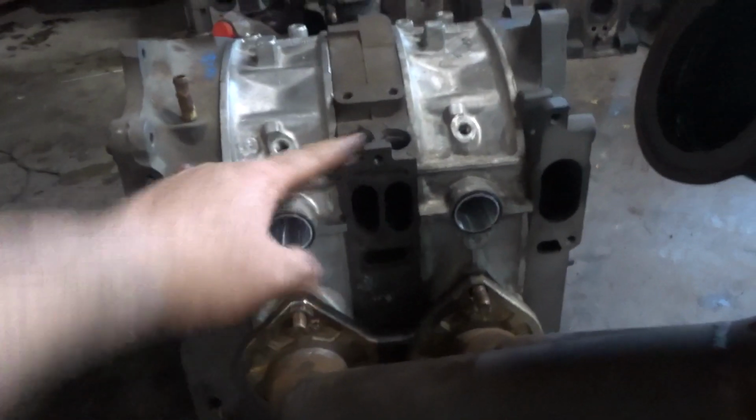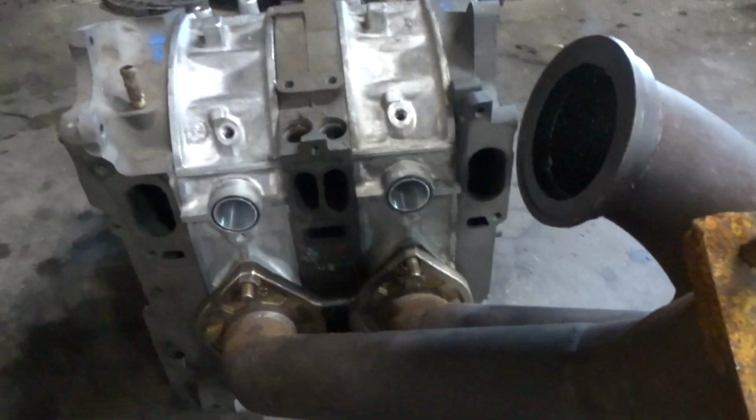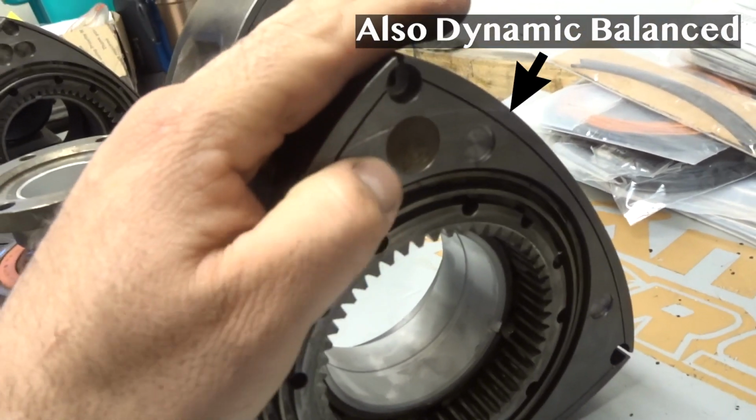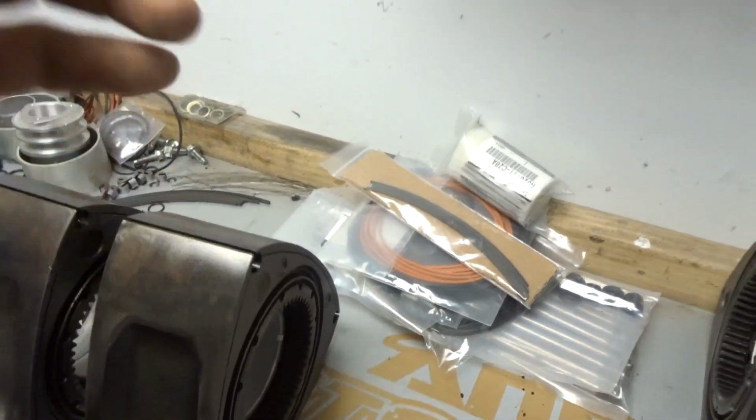And this is the Reboot 2.0. So same thing, it's gonna have street ported plates, semi-peripheral, same manifold. We're not changing anything. It's pretty much an exact replica of what it was engine-wise. New bearings on the rotors, and what we did, we just side clearanced them for high RPMs, and that's it. We're not gonna do nothing too crazy with it, and we're just gonna have fun. Do some burnouts, probably do some passes.